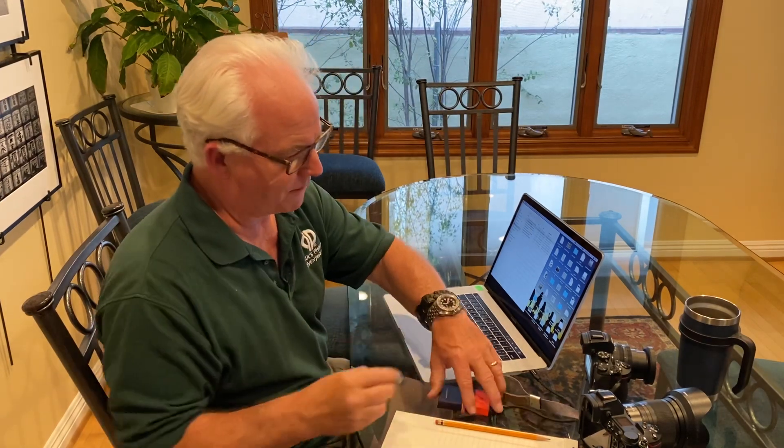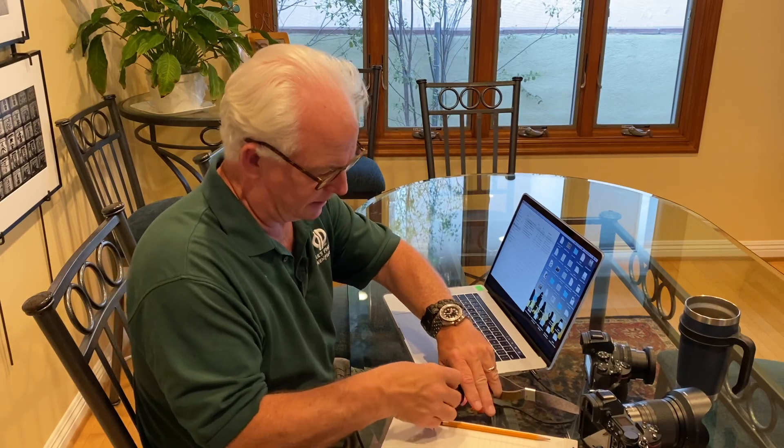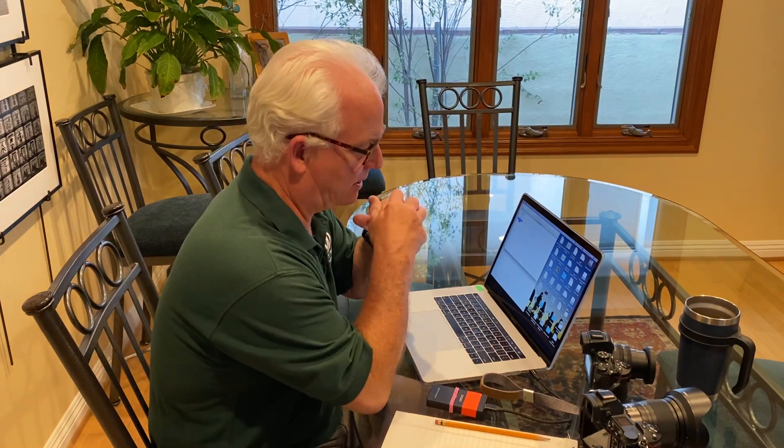I just got word that Nikon has also updated the firmware on a lens. How do you update the firmware on a lens? You do it exactly the same way. I've got the memory card — an XQD card for my Nikon Z7 — putting the memory card in. I've already downloaded the firmware for the 24-70 lens upgrade and I'm opening it just the same. Here comes the folder, there's the file, and I'm now going to drag that to the Nikon Z7. It takes a second to go across. I'm going to eject the memory card.